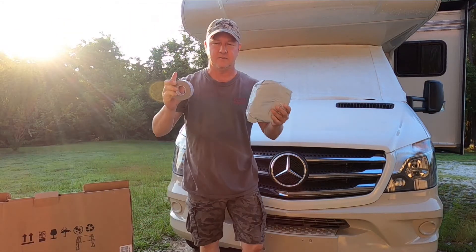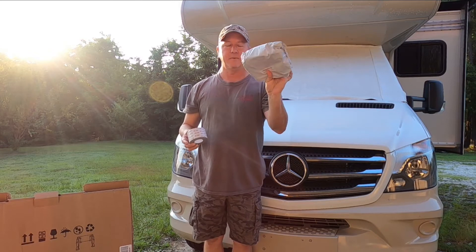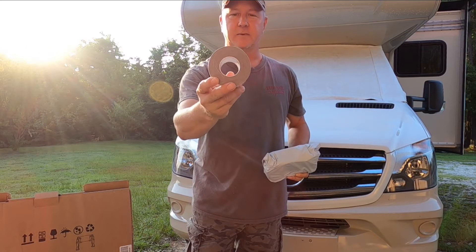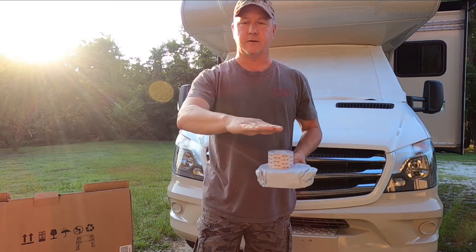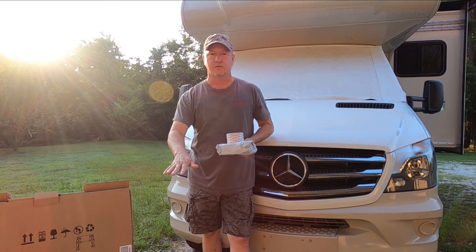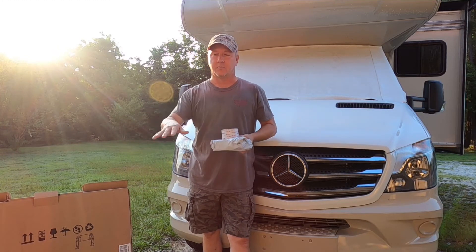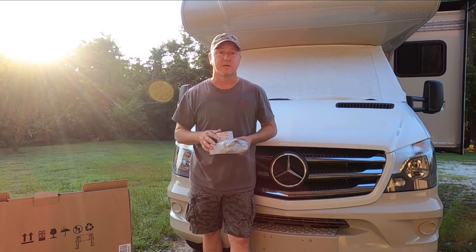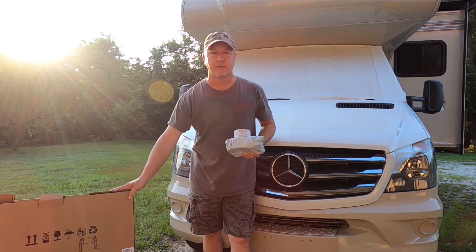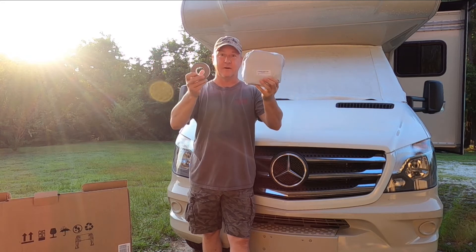What we're going to need is some cleaner for the roof. All I had to buy was some Eternabond tape and some two-sided 3M tape — one strip on each side and one down the middle. This will create an air gap between the solar panel and the roof of the RV, because I don't want it sitting directly on the roof. Solar panels can go up to 140 degrees in full sunlight and I don't want that baking my roof, so I want a little bit of airspace underneath — not much, not enough so it can flex. This is a flexible panel.